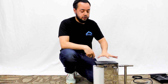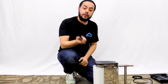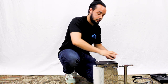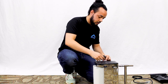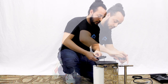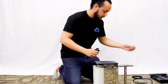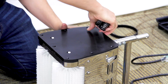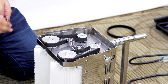First step is to remove this side panel here. You're going to want to remove the one that's on the same side as the foot switch. I'm going to use my eighth-inch allen wrench and go ahead and start removing the screws that hold the panel into place. Once I have all the screws out, I can go ahead and remove the panel, revealing the internal drives.